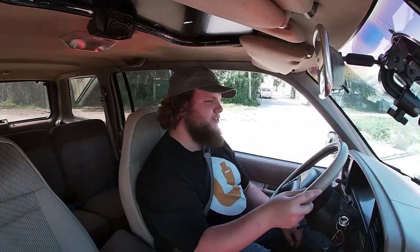In terms of actual driving experience — now I've shown you the reason I drive a vehicle like this. You might have noticed the steering wheel isn't sitting straight. There's quite a lot of play in the steering — it's a recirculating ball system like you'd find on an old G-Wagon or a current Suzuki Jimny, so quite old fashioned. It's supposedly better for off-roading because it's less likely to kick back at you, but as a trade-off it's completely numb to any sort of feeling. It's more than four turns lock to lock in this car, so when going around a tight corner you really have to move the wheel a very long way. The steering wheel itself is massive — definitely from a truck. It has a vinyl cover on it, cream-coloured, which I'm very thankful for on a hot day because the actual steering wheel underneath is black.